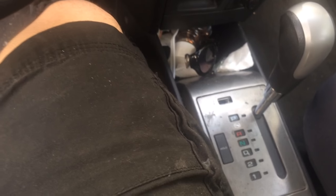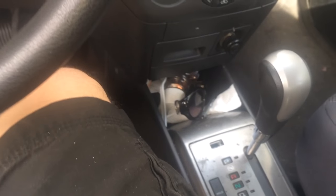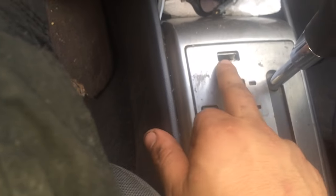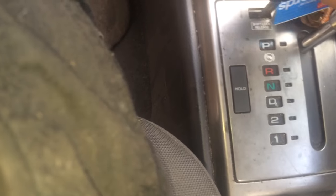Other than that, this was just a quick, easy fix. Other cars are probably different on switching out the brake switch, but this was pretty simple. So if you ever have an issue at a convenience store or something like that and you can't shift out, give that a try. See if you have that little lock tab right there — pull that tab off and get something to stick in there. You can actually use your key too.